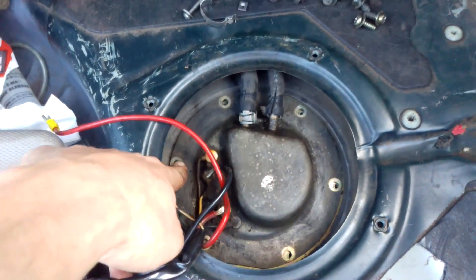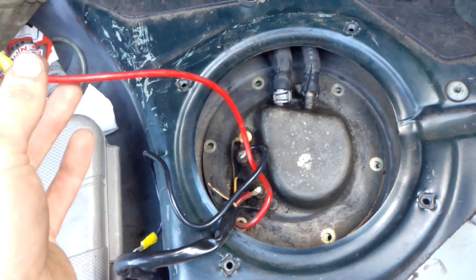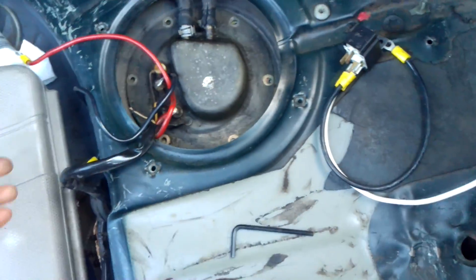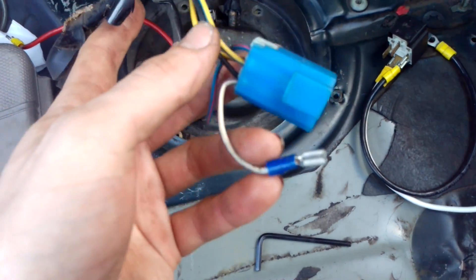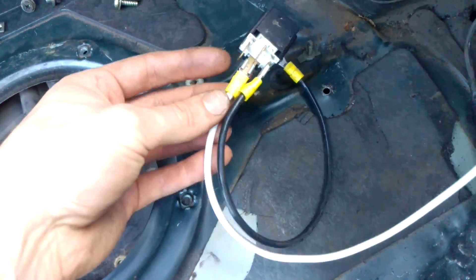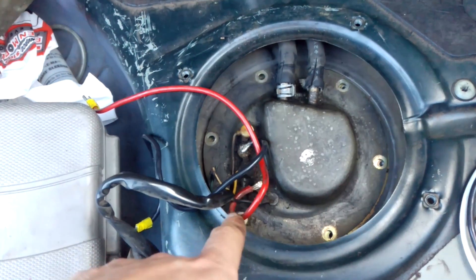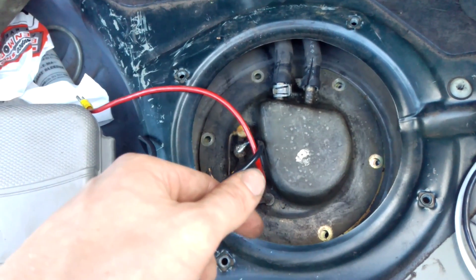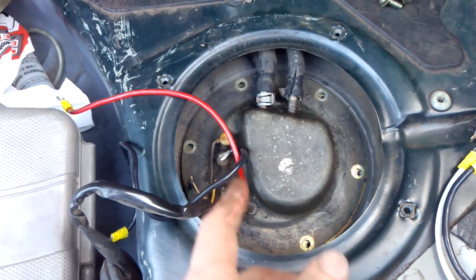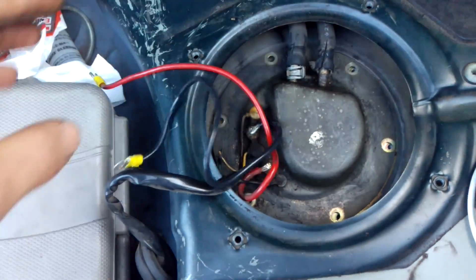Then undo all the screws around the sender unit. When you put a new fuel pump in it's going to run at a lot higher amperage than the factory one, so if you're upgrading from a factory fuel pump you'll have to run a relay setup. Using the stock wire on the plug — the one with the purple line — run that to your relay, add the relay to earth, then run a 30 amp cable from your battery to the positive on your fuel pump. You have to run a beefy cable both to the top of the pump and from the housing to the pump itself — there's no point running a powerful cable to the pump and then running factory wiring after that.